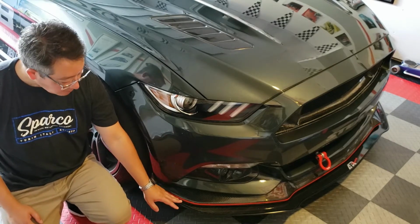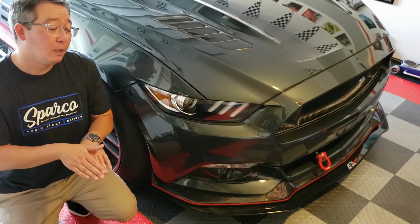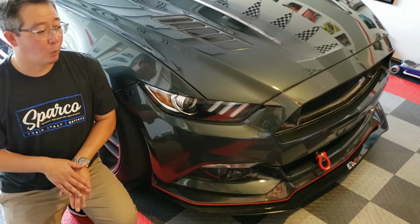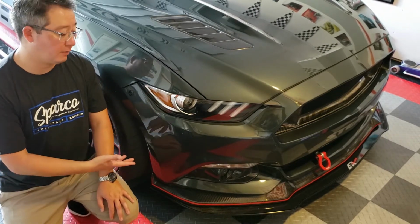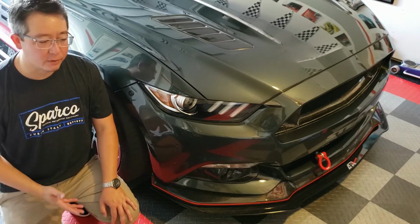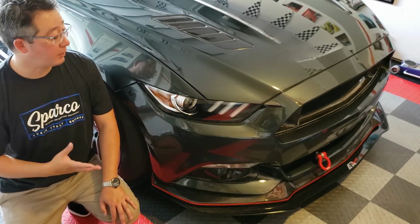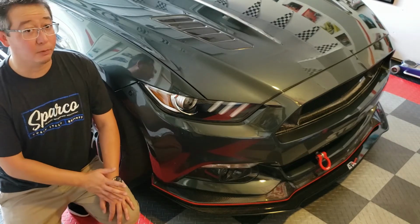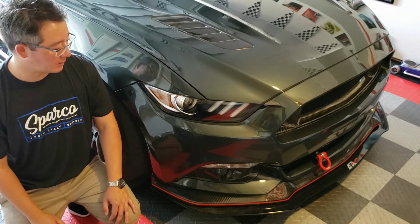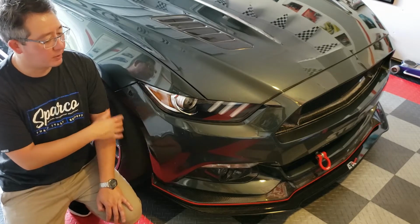You'll notice there's a big fat weather stripping here so that we can get the right angle. Previously, it had an upward angle, and that's what we thought was washing away the positive effects of the splitter. I know I went through a lot there, and it might have been confusing for some, but the whole thought process is that this has to be a functioning piece for me. A lot of folks use it for aesthetics, and hey, it looks really cool. I'll give them that. But I actually wanted the positive effects. I also wanted an extra mounting point for the front bumper to secure it better.